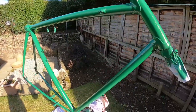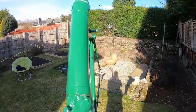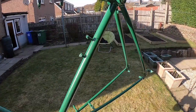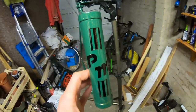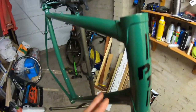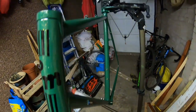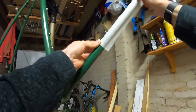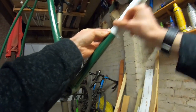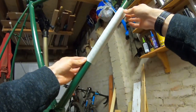Unlike the paint, you do need to do a couple of coats of the top coat. It is stated as being cured within two hours, but it is recommended that you wait 24 hours or more before building the bike, just to give it time to be fully set. Once the paint is fully cured you can apply the decals. I wasn't actually sure whether I was going to use the decals I had because I thought the black and the green might be a bit odd, but in the end I decided to go for it. It's a good idea to test it before doing the whole job because there is the risk that the top coat can make the decals pucker or blister. Luckily for me that wasn't the case, so I was able to get on and apply the full lot.